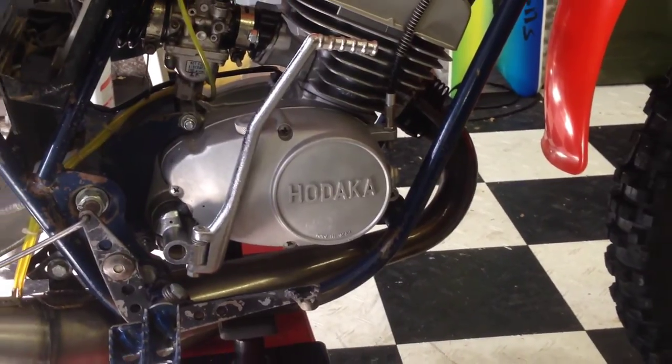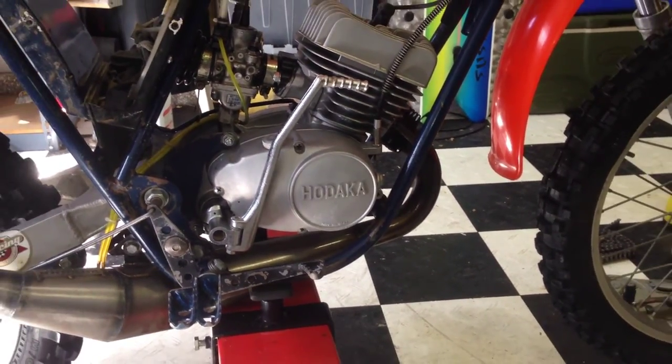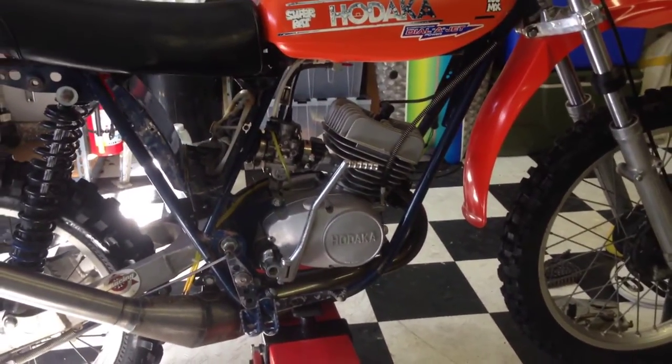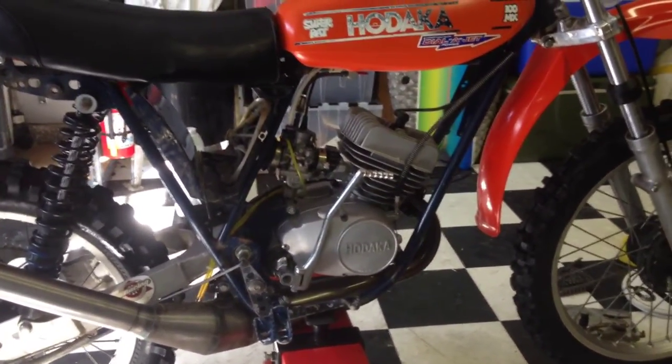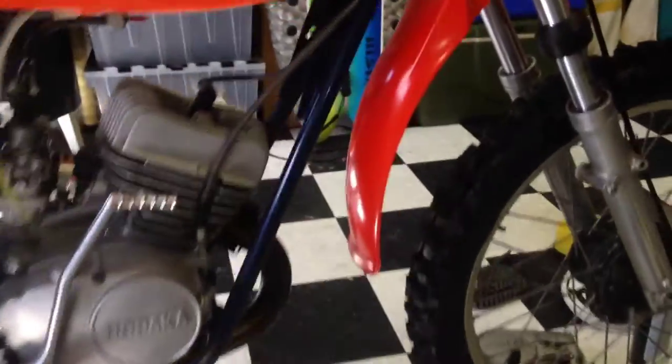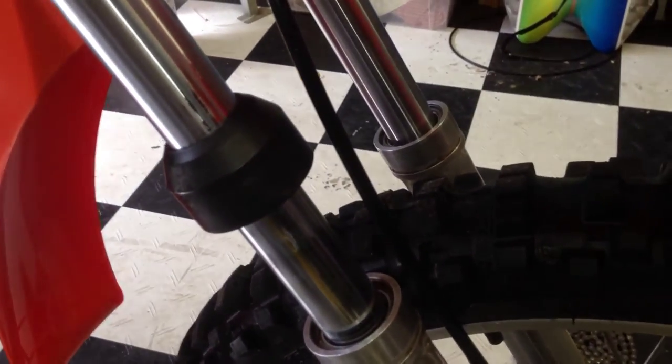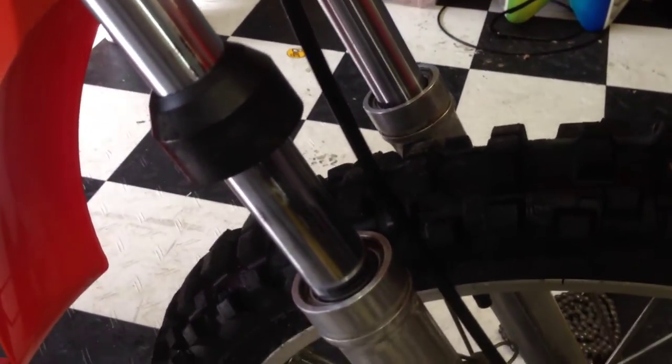First I take it outside and give it a good wash. It was pretty muddy, so just a good pressure wash — I definitely watch out for what we spray. Then one of the first things I do is pull up the fork seal covers, make sure this area is all dry and clean of debris, wipe down the fork tubes so there's no water deposits left on, and then leave the covers up to let that really air out.